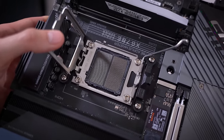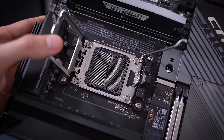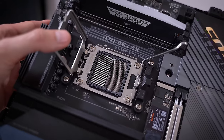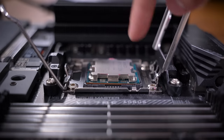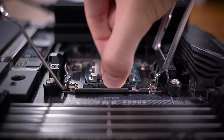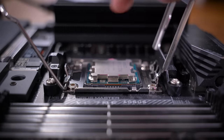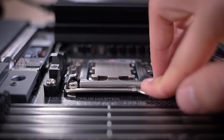I'm going to apply a bit of force to get the CPU to sit all the way, and I think it will with just a small push — then we'll try powering back on. I'm ready to replace the motherboard, but if we can get this to work again, we might be okay sticking with it. You just have to note this going forward: if you replace a CPU or swap one out, mind the tolerances of the socket — it might have been warped from the heat of that AIO. Dropping a CPU back in — the right side is all the way in, the left side is not. I push down a bit, and it goes all the way back in. Let's see if we get a post.